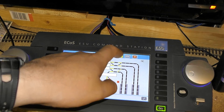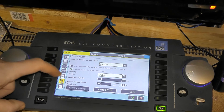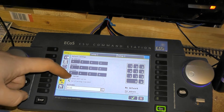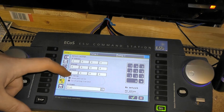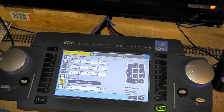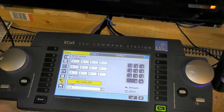So you click on your settings symbol, click on IP settings, then turn off static IP, turn on 'get IP address', and then turn on the DHCP web server. You then press OK and set up Wi-Fi.